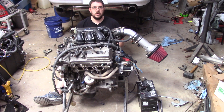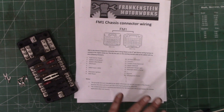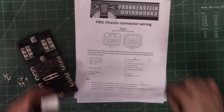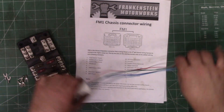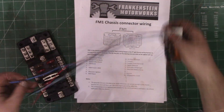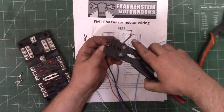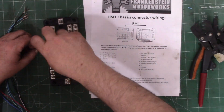So let's go to the bench and whip up a quick bare minimum wiring harness. We're just going to use this temporary fuse box. We're not wiring this to go into a car at all — just wiring it to see if it fires and to see if the immobilizer disappears. I went in my wiring harness pile and I was able to dig out the appropriate terminals. I got this thing populated for fuel injector power, ignition front and rear, AFR power even though we don't have any AFR sensors yet, drive-by-wire power, and mass air flow power.